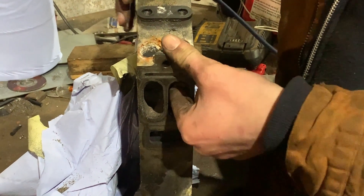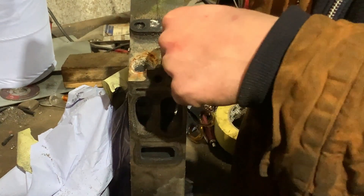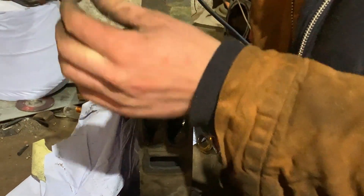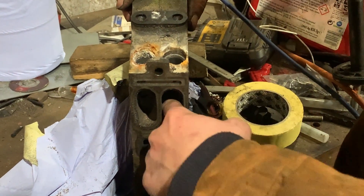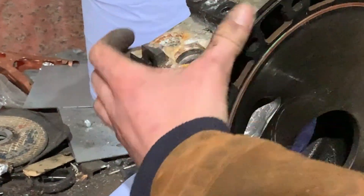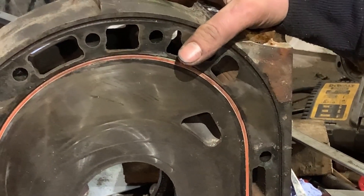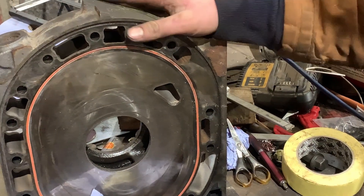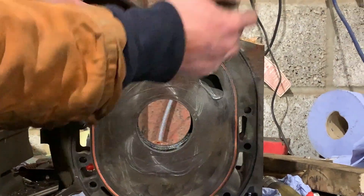That's actually coming out. I need to port it here to make sure it's smooth and there's proper airflow. This port is done. As a comparison — this versus the stock port — I think it's a nice increase in airflow with nothing too drastic. Now I need to copy that to the other side. Porting them here is finished — they're near identical.